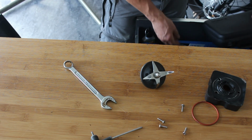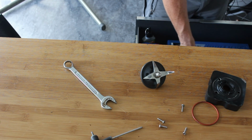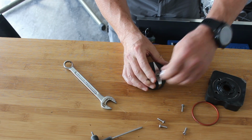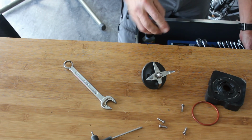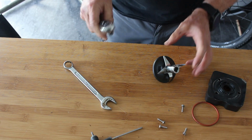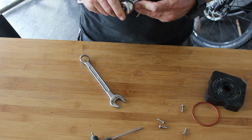spanner out. Hold on, I'll quickly look in my drawer, because I know which one it is. The drawer's sat next to me right now. It is an 11/16. The 11/16 spanner seems to fit in such a way that it just locks the pins enough for you to be able to pop it off. 'Tis a left-hand thread as well, so that's all I'm explaining there, that it's a left-hand thread.